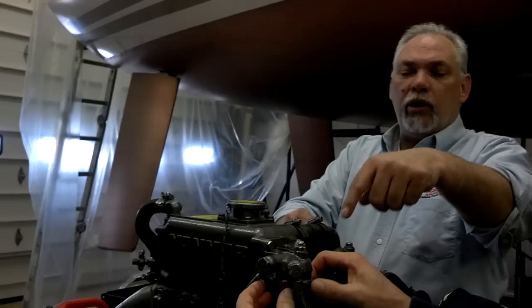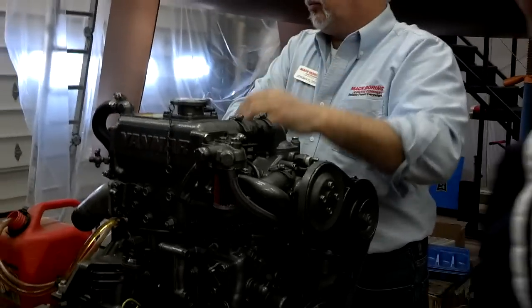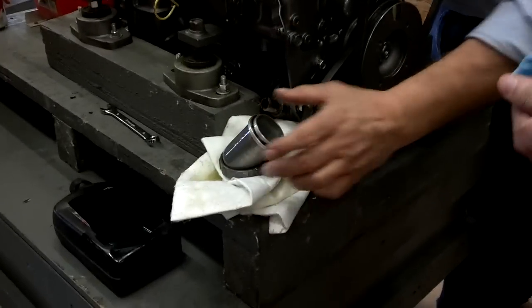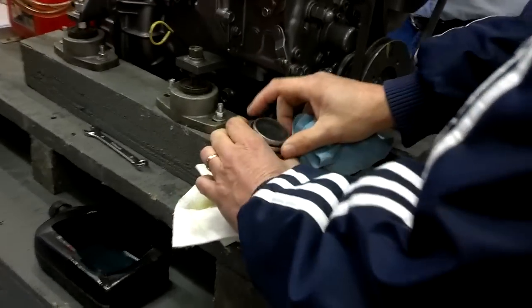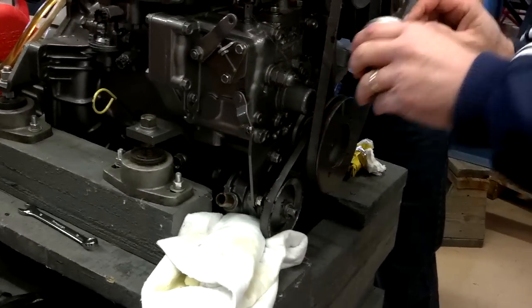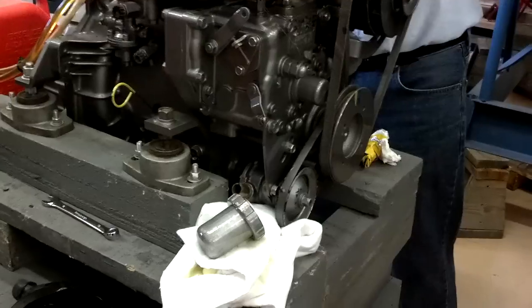You never want to run without a fuel filter. Now, in this fuel filter housing there's an O-ring in here. I always recommend — because the O-ring is sold separately, one each — I always recommend having one fuel filter and two O-rings. Because sometimes I've screwed up, messed up, lost it, cut it — so I have a second one.